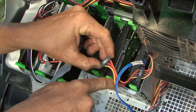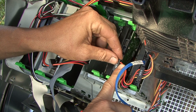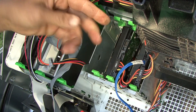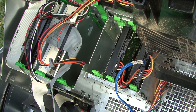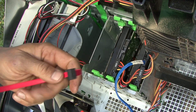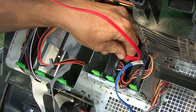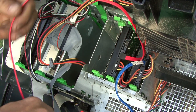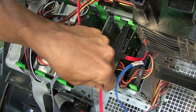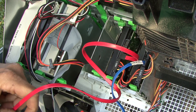The next step is the power cable — this goes up into the first slot right here, and that one's already done. Now the next thing is you have to add in the data cable, your SATA cable. It's pretty simple — route this one down, and I'll break out the camera to show you more where this plugs in.